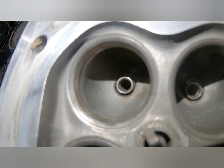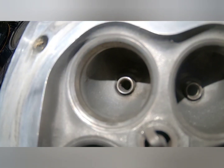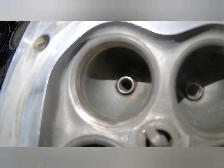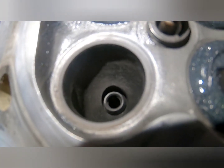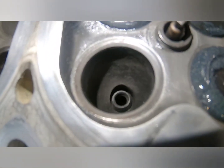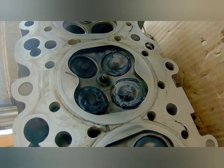This is what an unlapped valve seat looks like. As you can see at the bottom of this intake valve, there's a dark spot and that is from corrosion — so that could be a potential leak. Once you look at the ones I've done, it's all nice and smooth and everything's already touched by the compound. Now I'm going to finish the other three that I haven't done yet, and I'm just going to time-lapse it.